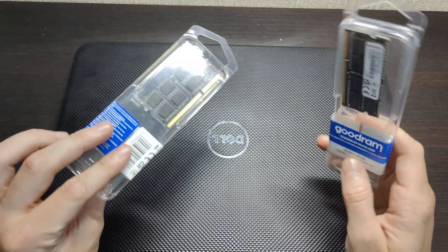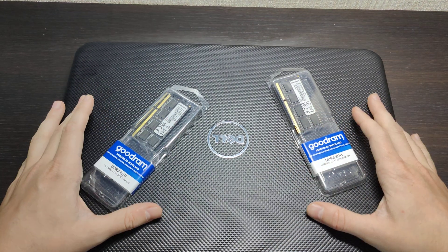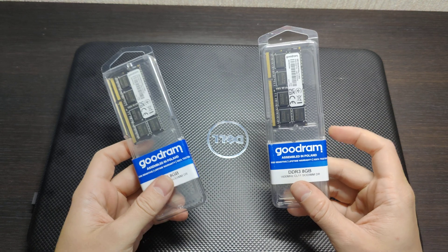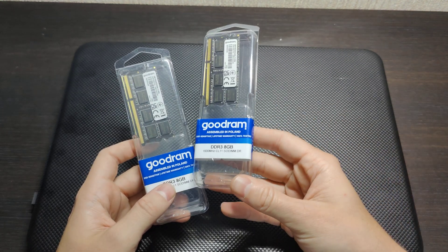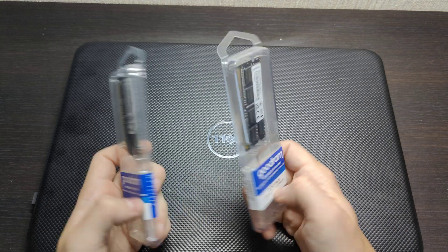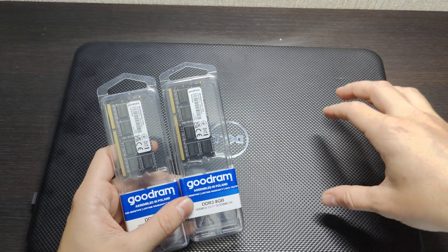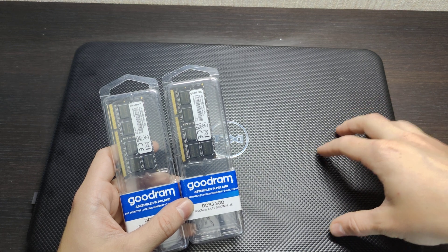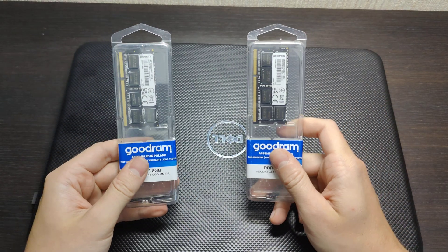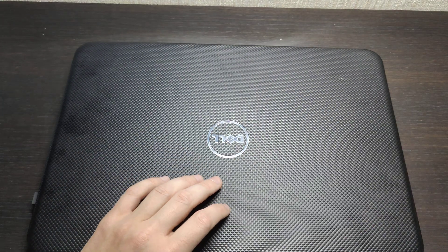Today we have a quick installation and upgrade of a quite old laptop — a 2014 Dell 3537. We have a RAM upgrade: DDR3 8GB sticks assembled in Poland, 1600MHz CL11. I've got two of them, so 16GB total, which is what the Dell 3537 chipset on Core i7 supports. Currently I have 8GB (4+4) and I'm planning to install 8+8 for 16GB total.